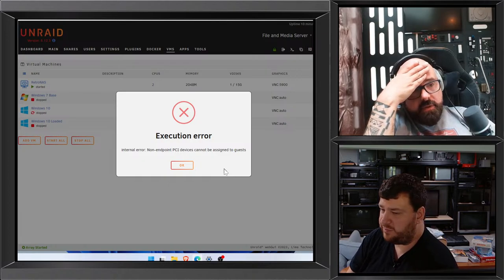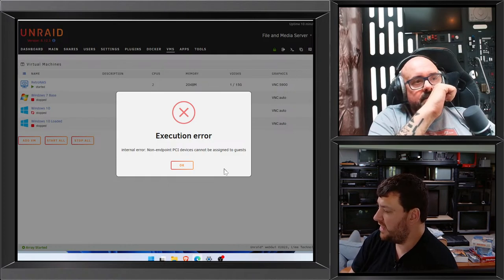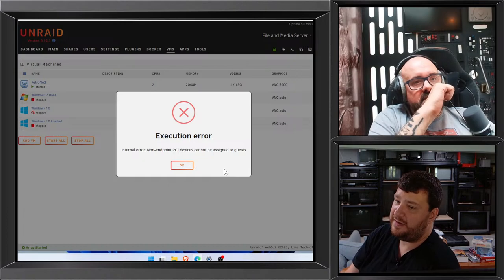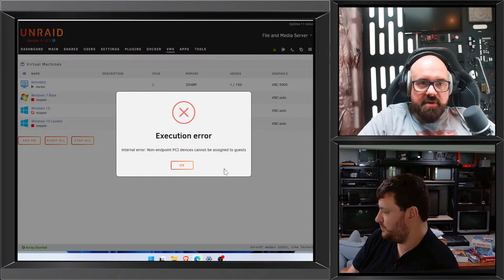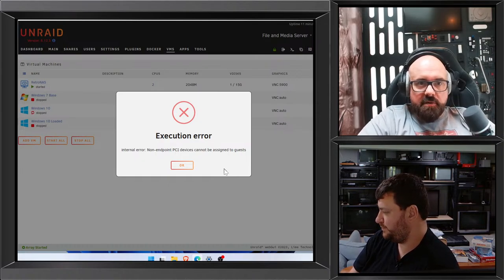So this might actually be completely relevant to this stream and to what other people might be trying to do, because if they're lucky enough to find a 2018, 2019 motherboard like this one that has a PCI slot, they might think, well, I could find a PCI Sound Blaster, so that's perfect, I could just put it in and use it. But they would run into this exact same scenario, correct? Yeah, they may well do. I think it's a lot better to use an adapter that you know you can put into a PCIe slot, and then it's not part of the actual motherboard itself.